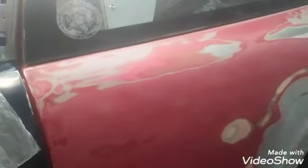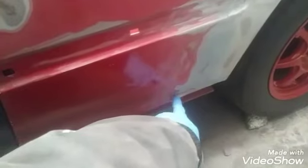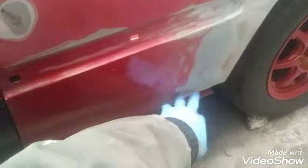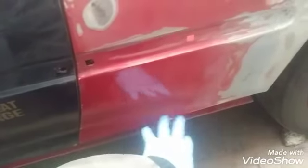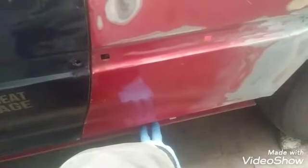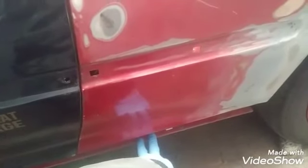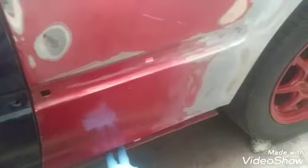The other side is welded. It's a lower spot that I found when I grinded — I was better off cutting and putting in a little section, so that's the only reason I haven't filled it in yet. Everything's strong and solid. The rocker panels are factory, so that's right on the money because I don't have to spend money replacing that. It's a good solid shell.